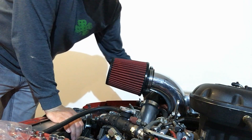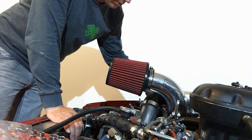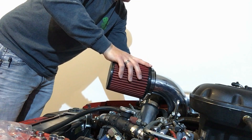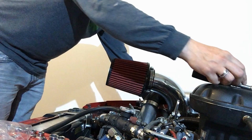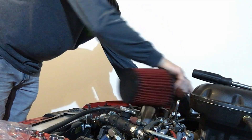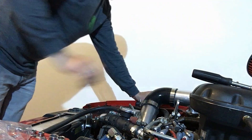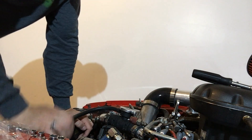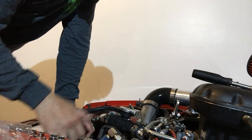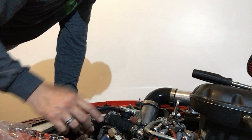I went for more boost because I wanted to have as much boost as possible. And after doing that, I learned firsthand what heat soak is all about. Heat soak on a supercharger happens when you spin it too fast, too long, or it's just an inefficient blower.